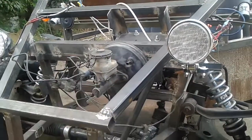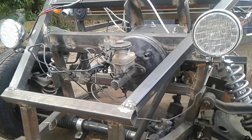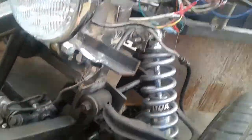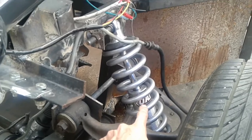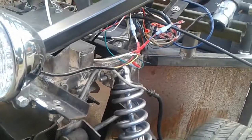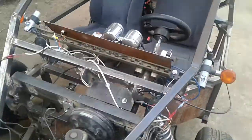The headlights are from eBay. The power steering unit actually came out of a Honda Civic, like an '03 or '04. For the shocks, I used coilovers like a race car — I chopped the upper control arm from the Mazda Miata and put on QA1 shocks, which are great. You buy the shock and the spring separately and fab the frame to take them. None of this stuff is finished — it's really just roughed in, though it is drivable right now.